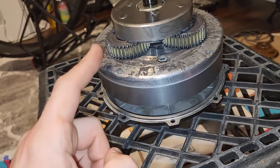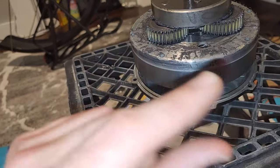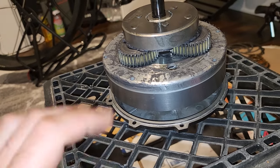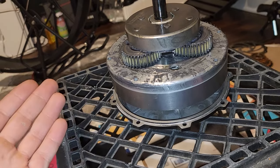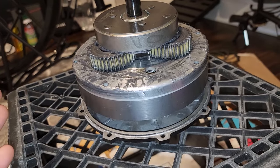And so this is kind of like a car tie rod. If you guys are familiar with tie rods, they're these really thin bars that connect your steering to the wheels in your car. And those are thin by design, because you'd rather have the tie rods fail than something more major fail and have it be more expensive. So durability isn't always the best thing.